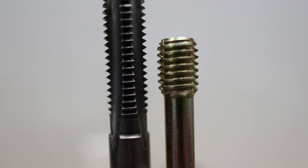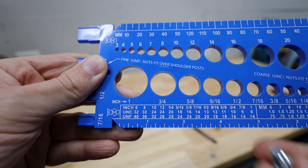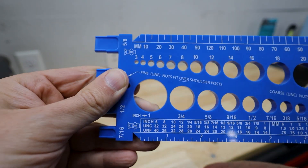Plenty of you are probably still thinking like I used to — who cares, I can still use a tap, run it through a hole, and as long as it follows the existing threads it'll clean up the junk and freshen up high or low spots. But the important differences come down to this: taps are really sharp and they're not actually the same size. These are side-by-side M8 by 1.25 thread pitch — look at the working edge of both the chaser and the tap. The tap is so pointy and sharp compared to the chaser, it looks outright dull.